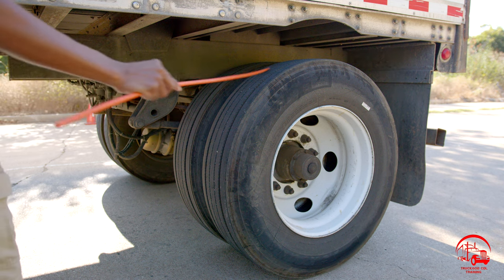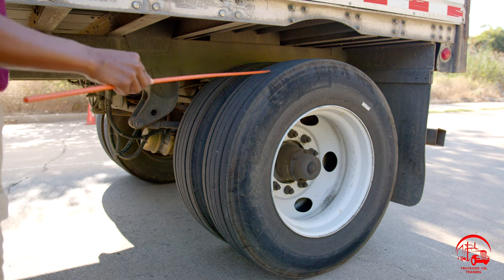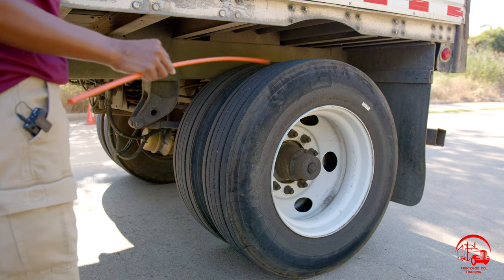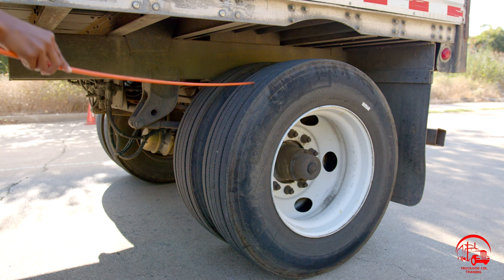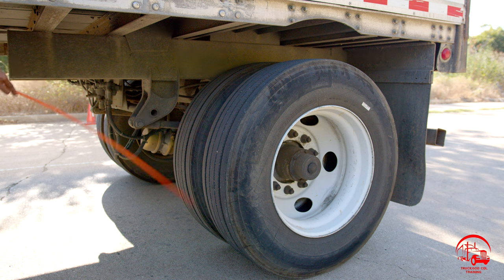We have the top of our tires on both wheels, properly mounted and secure, not bent, broken, or cracked. There are no abrasions, bubbles, cuts, or dry rots. They are evenly worn. There's no less than 2/32 tread depth, and they are not leaking. In the center here, we have our wheel connection, which has no gaps, no grease, oil, or debris.